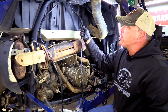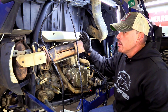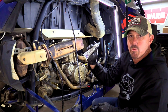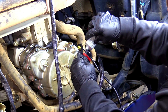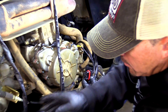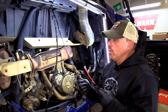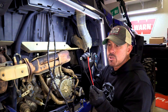We're about done — all we need to do is run our wires. We're going to zip tie them up, and you want to make sure when you're running your wires you don't run them over anything hot or sharp, because that'll ruin a good day's ride once you burn through them or cut them. Ricks has a really nice heavy-duty sleeve on here, but you still want to use caution. We're going to use some dielectric grease when we put our connectors together — anytime we're working with electrics, we like to use dielectric grease. You don't want to put on too much — just basically enough to glaze it. If it's squishing out the sides, you have too much. Put them together and that's going to click — that's it, that's together. Another wire you're going to hook up coming off the regulator is a positive and a negative wire going to your battery. This is on both regulators, so you'll hook these up directly to the battery.